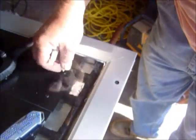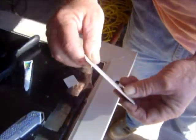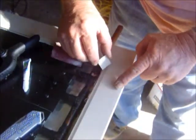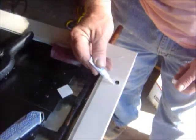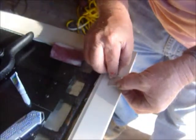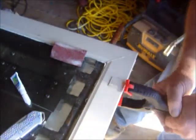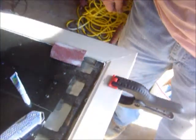Finally, we need to fill over these holes right here. What I've done is cut the flange off of the door frame itself and make some little patches like this. I've sanded both sides. I'm going to attach it with some super glue — put it right around the hole where it's going to need to seal — and clamp it. Then do the rest of them.